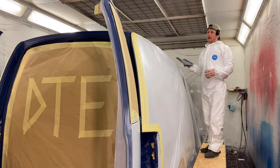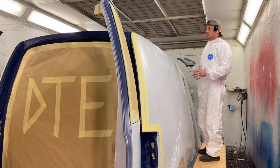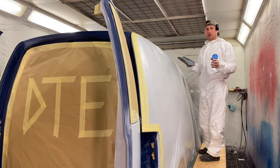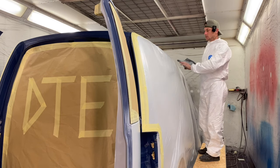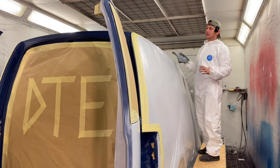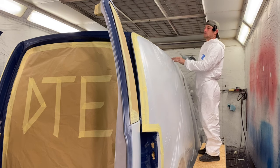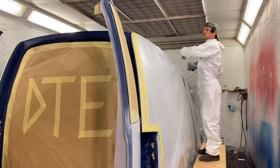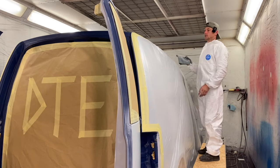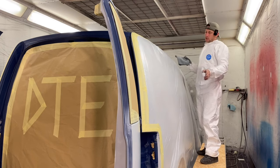Now, most of the van is gray. And because I want the red, sometimes when you paint a car, if you've got a different color base coat, ground coat, it shows up a little bit different. Most of it is gray now, so I have got the other Nathan to mix me up some similar gray in base coat. I'm gonna get some gray over the blue areas, and then I'm gonna go over with the red two-pack. It should all blend in.